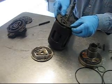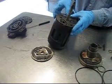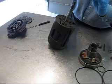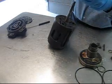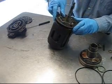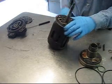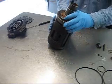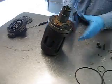Set this on end. The next thing is to re-stack the valve plates. Quite often there are witness marks where they were, and you can actually only go on one way. One plate down, then your second plate. Take your front housing and set it down onto the compressor — it sits on roll pins and should sit right there.